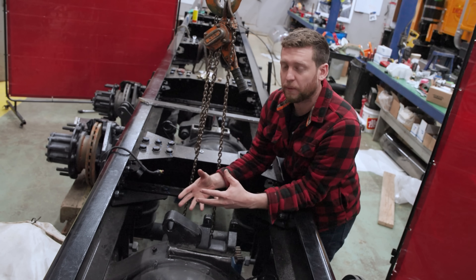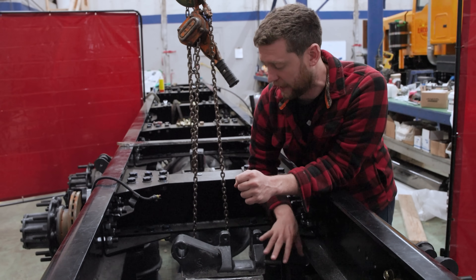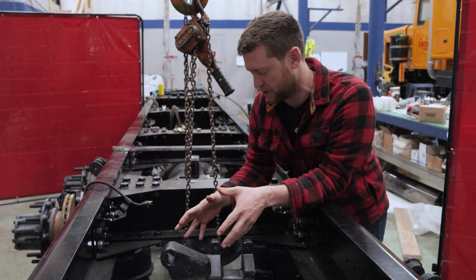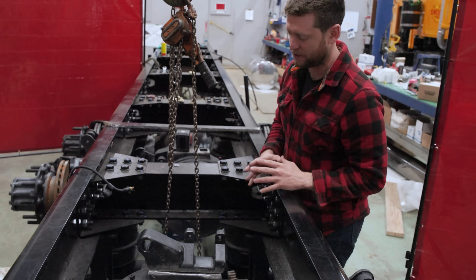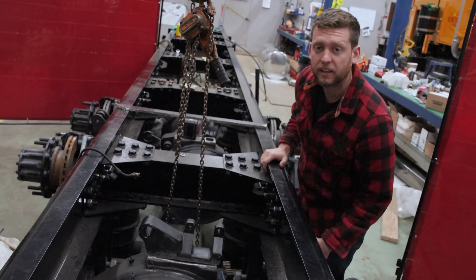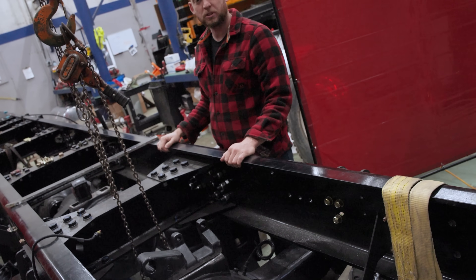In the future, I would love for these axles to come with all of the torque rod mounts already attached. But when you order an axle, you normally just get a bare axle and then you weld your own on, because when you're buying aftermarket they don't know what truck it's on. I would love to get it to where this is already attached and ready to go, but we need to place a serious order quantity for that to happen. So right now we'll get these welded on, get the torque rods on, get the hangers on these axles, weld the axles onto the hangers, mount everything in place, and then the axles will be done.